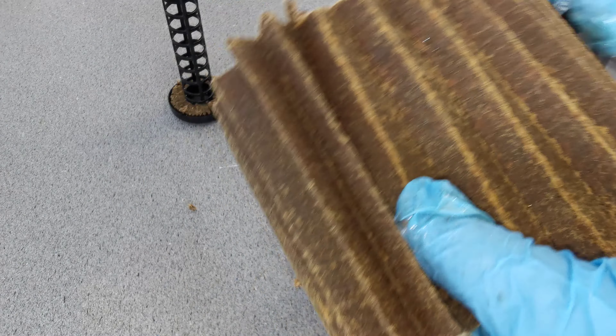Hopefully you can see that — the sparkly bits in there. She's quite sparkly. We're going to have to do something about that. I'm getting that new oil filter housing coming in, and hopefully that'll take care of the dry starts and everything else with the Jeep. As you can see, the filter is pretty clean, except for all the metal flake. This was just going to be a quick one, so thank you very much for watching, and I'll continue to bring you oil filter reviews. That's what I do. Thank you.